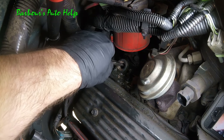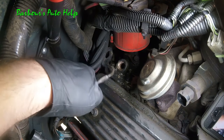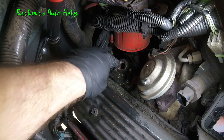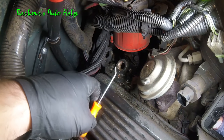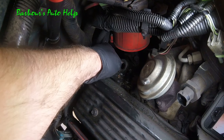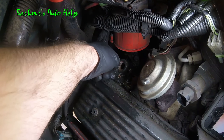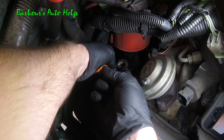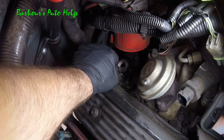Go ahead and grab what you can. I think the best way to get that stuff out is to use a wet/dry shop vac with a modified tip that's skinny enough to get down in there and suck all that stuff out. At this point you can take a crooked pick and run it along those threads to dig out the rest of the material and get it really clean. If you can take your shop vac and stick the hose up here while you're working — kind of like at the dentist — that'll prevent some of that stuff from going down in your intake too. You've got to get creative sometimes.